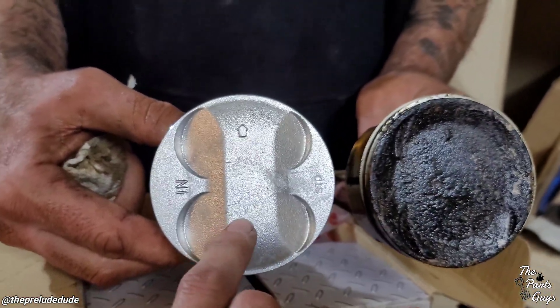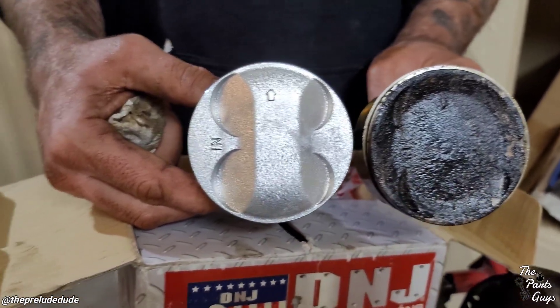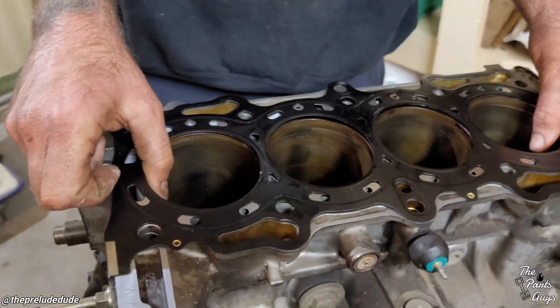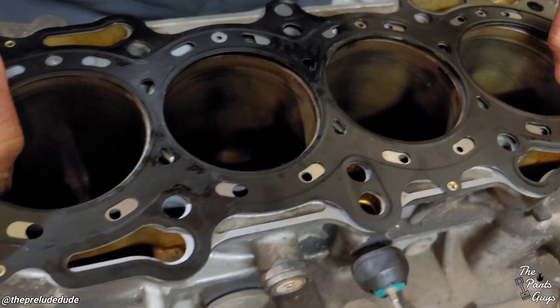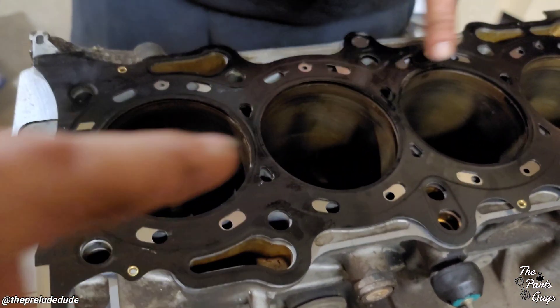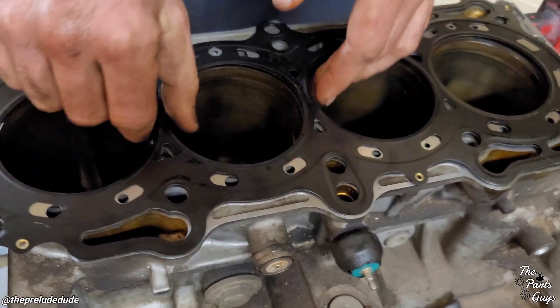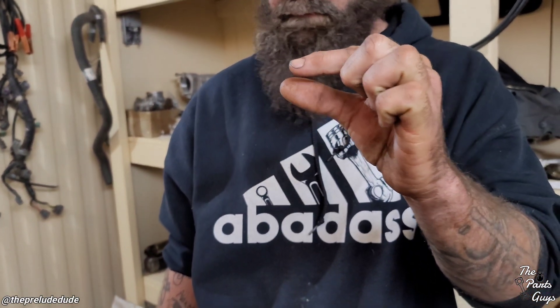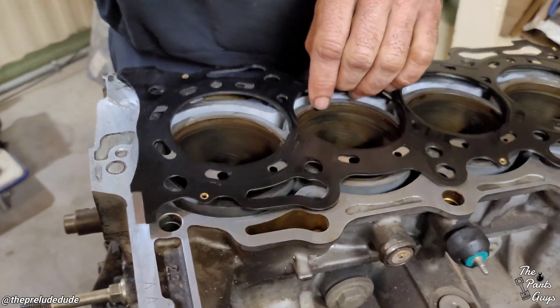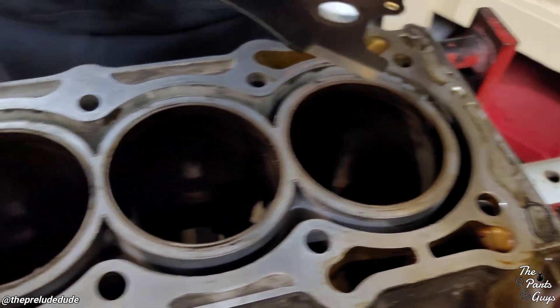So that's definitely going to have a higher dome on it, so that's going to be higher compression for sure. So what I'm going to do is fill this with JB weld, and then drill just the holes that are needed — all these holes — so just enough coolant goes through. Only the holes that need to be there, which is going to be, what, a quarter inch? Yeah, something like that — a quarter inch thick. That's all the plate usually is, maybe a little bit more. Well, it's JB weld, so I might make it a little thicker.